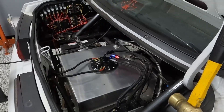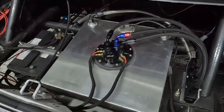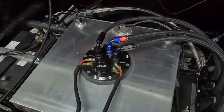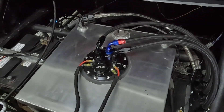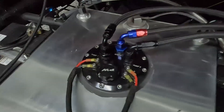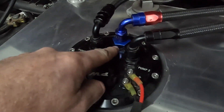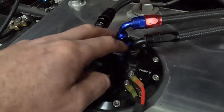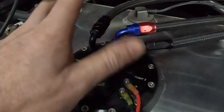So this is the trunk of the car and this is where all of the magic happens. What we've got is — I think this is a 13-gallon fuel cell, it's made by Performance World — and we've actually got their dual pump hanger here. Now what's nice about this hanger is it's very reasonably priced. For all of you Americans out there, check out Performance World — a Canadian company, Canadian prices, so you can get a pretty good deal on parts. On this dual pump hanger I've hose-clamped a third pump to it and ran it up out the return, so this is now a triple. We've got a 450 as a primary pump, then a second 450 and a 340 which are staged outputs, which I'll go into in a minute.